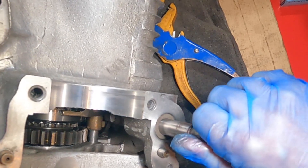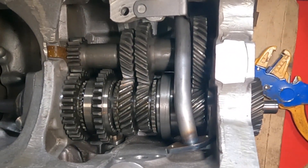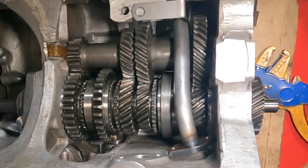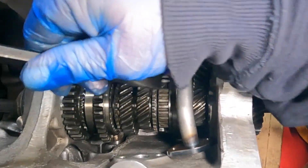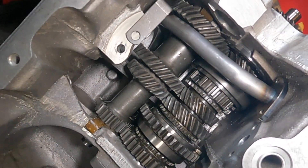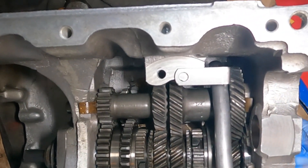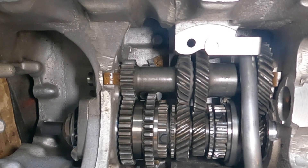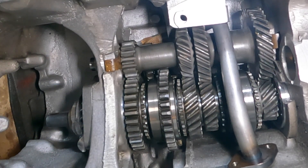Now what you have to do — I don't know whether you'll be able to see this on the camera but I'll try and show it you — you have to move the spool basically out the way so it's not selecting any gears. What that enables you to do is knock the gearbox into two gears at once. So I normally lock them into fourth and first. That's moved over enough, and the other way — fourth and first. So now that gearbox is locked, it ain't moving nowhere. So what I'm just going to do now, I'll torque up these two bolts and then we'll come back onto the next step. So I've locked off those two nuts — the pinion nut and the first motion shaft nut — to 150 pounds foot of torque, and I've locked over the lock tabs.